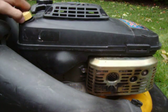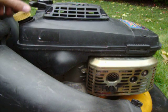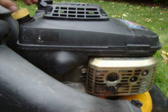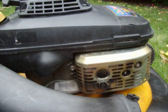I believe this is done now — it might still be draining. Check the oil level — it's almost done. I'm going to wipe this off with a rag. Nothing in there, just a little bit on the bottom. You're going to want to wait a little bit longer. If you know where your drain plug is, down on the bottom, tilt your lawn mower that way a little bit for the last few minutes to drip all that you can out of it, because you want all that motor oil out of there.